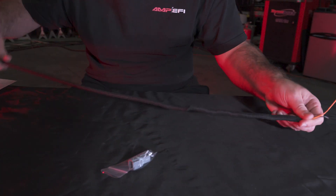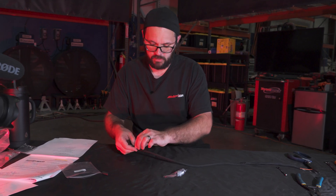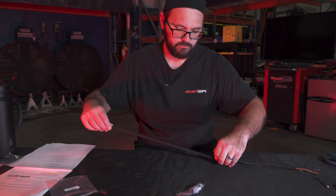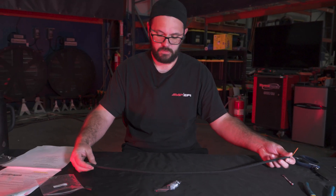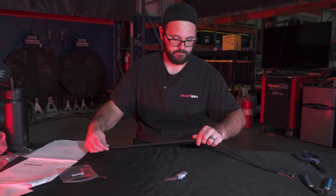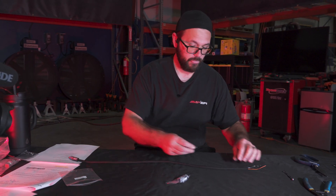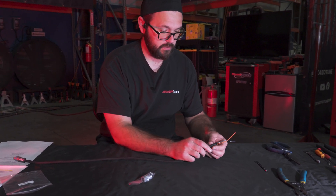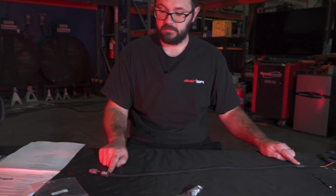There we go. Because this is a woven wrap, we're going to come back to the edge, put a finger inside the leading edge, and just work our way down to straighten the loom back out — and we are loomed. On larger pieces of this type of wrap, we want to twist it and that'll just tighten it up on the wire a bit. My suggestion at this point is to take the other piece of heat shrink and slide it over now — if you don't, you will forget about it; it's almost guaranteed. Now we've got heat shrink on both ends and the loom applied.